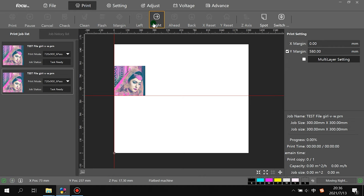You can also move the carriage to back side or front side. X reset makes the carriage go back to home position at zero. Y reset makes the table go back to Y position zero. When you change the Y position number, the printer starts to move to the front. For all movements — left, right, ahead, back, X reset, Y reset, and margin — the table must be clean with nothing blocking the carriage or rail, especially liquids like drinks or ink, otherwise the liquid could fall and damage the printer.